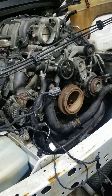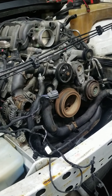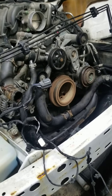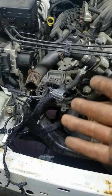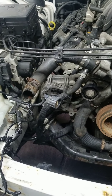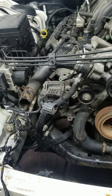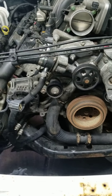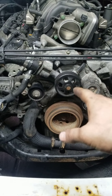So we're going to see how this goes — probably give me another hour and I'll have all of this taken off, possibly sooner, just depends on whether the bolts break loose freely or if they're going to fight me. Another trick you could do is leave the alternator attached to the timing cover, just unbolt the power wire from the back side and unplug it, and wrap a rag around the power wire because this car still has power connected to it. Or just disconnect the battery, unbolt and unplug it, drop the AC compressor down out of the way, pull the harmonic balancer, and all of this will come off as a unit — you don't even have to remove the water pump.